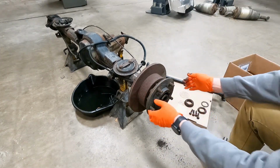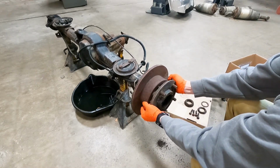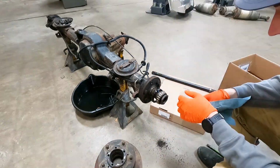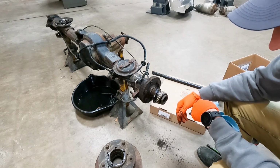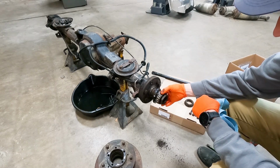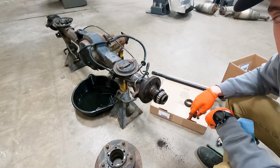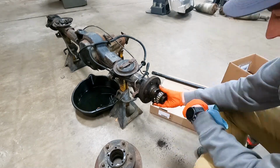Pull it back off and rip the bearing and the seal on the back. Oh, okay. There you go. So here was a top tip from Ted. Nut back on and just pull the rear bearing out via the nut. The separate bearing and race deal is before my time, so haven't done a whole lot of these. But also, probably shouldn't have that much rust popping out of that, so good thing we're going through these.